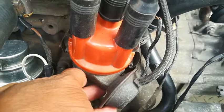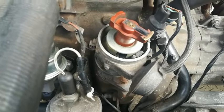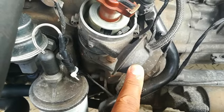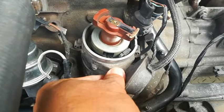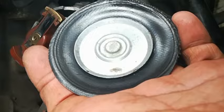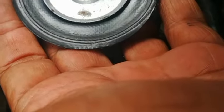As you're driving at cruise speeds — it's normally just at low speeds, not at high speeds — when you're going between 60 and 75 and driving in traffic. Now what actually happens is inside this vacuum advance there is a diaphragm, and that diaphragm also starts wearing out. It starts getting little holes and tears in it, which means the sucking action is not 100%. When I'm speaking about a diaphragm, I'm talking about something like this — you get little tears and perforations in here.